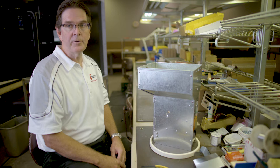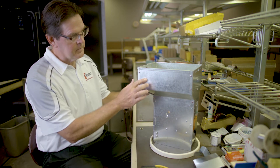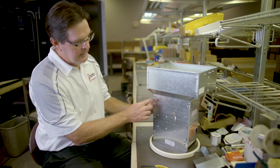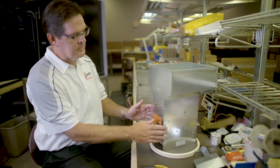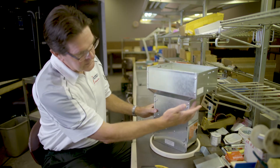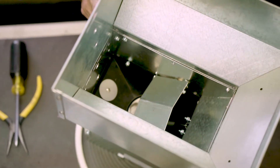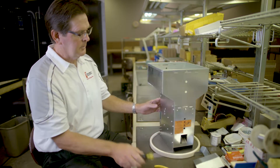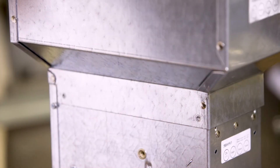Now that we've removed the hopper, let's go ahead and install the new parts. We're going to start by removing the upper cassette. There are four screws, one on each corner, that I need to remove to pop that off. Also take notice that on one side the hopper overextends and the other side it's flat. When you go to put this back on, make sure the flat side is on the chute side. I'm going to go ahead and remove this, pull it off, and set it aside.